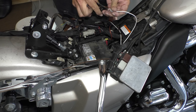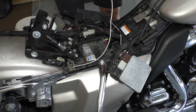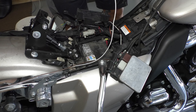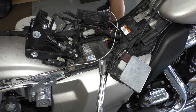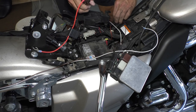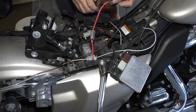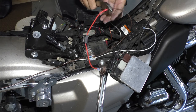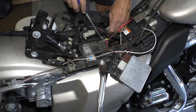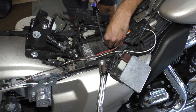To install this, first I'm going to choose two wires to use as the power supply to the controller. I used the white as the ground and the brown as the hot lead. The hot lead is the one that connects to the battery's positive terminal. Be sure to install an inline fuse on this wire, and for the fuse value, check out the instructions that come with the controller. When you've done that, connect these leads to the battery.